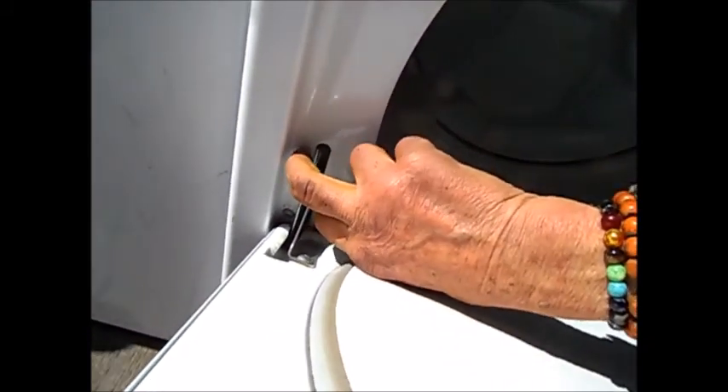What we're going to do is take this apart and bend these tabs back in to adjust the door. I try and push this back in as far as it'll go, hammer this part back. Also, if you close the door with something like a screwdriver inside it just a little bit, it puts a counter-bend on it so you can adjust it a little bit this way as well, and that would fix it.